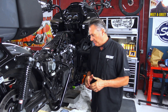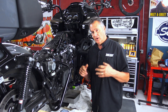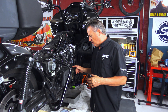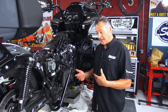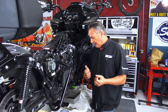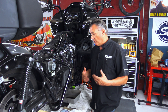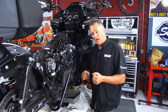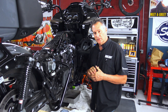It's not going anywhere. It's not going to loosen up. But I've seen so many videos recently on YouTube and Facebook where guys are asking what to do because it's broken. They're breaking it because you've got to use heat. Use heat! You'll even notice on some of the side cover screws, guys hit them with air or electric guns — I don't like electric, I like air, I'm old school. I just use a regular ratchet so I can feel it. Sometimes you have to hit them with heat to break up that lock patch, because if you don't, you're going to snap screws. Once you do that, it makes for a really bad day. So use heat on the fasteners if you need to. Do it by hand — you can feel it if it's starting to gall or bind, and you know to stop. Take some time, hit it with more heat, maybe some penetrating fluid to loosen things up.